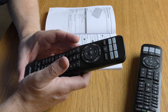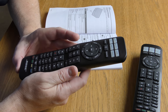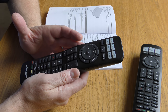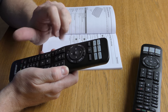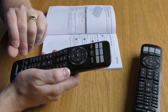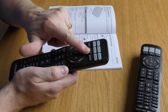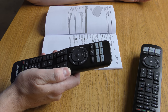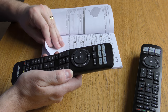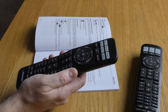There's a really nice feature where if the Bose detects a signal as you turn on the TV, Sky box, or whatever you've got connected, it will automatically wake up the Bose. To enable that, press and hold the Standby button for five seconds — the Bose itself will bleep three times in a rising tone. To disable it, press and hold Standby for five seconds again. It's great: as soon as you turn on whatever source you're using it will turn the Bose on.